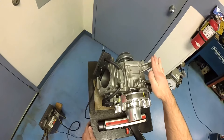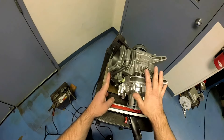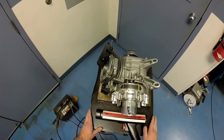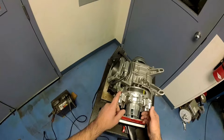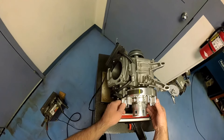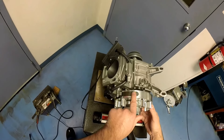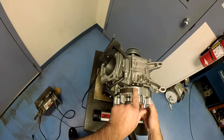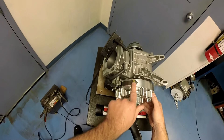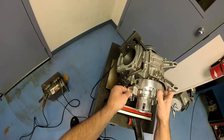What I'm going to show you now is how to check where the coil is firing at on your flywheel with a timing light. This is rather important because if you're setting your timing off a degree wheel with a dial indicator, you'll need to know exactly where the coil is firing in reference to the magnet. All ARC flywheels are designed originally to fire when the leading edge of the magnet — as the engine turns, the first line — is in line with the right-hand edge of the coil.